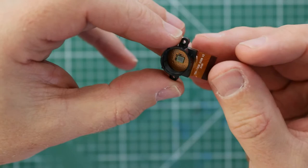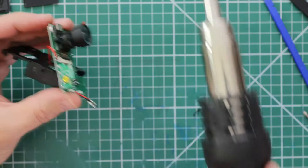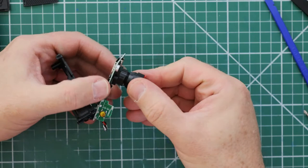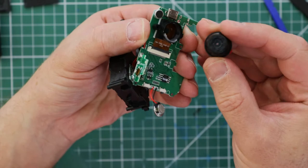The next thing to do is take either a hairdryer or, in my case, a hot air soldering station and gently warm up the glue on the lens thread. It doesn't take much to soften the glue and you can gently unscrew the lens. Please don't force it — you won't need a pair of pliers like I've seen in other how-to videos. By hand, the lens should break the seal with the glue and then you can completely remove it. You may find a blob of glue still attached to either the lens thread or the lens unit, which you can simply remove.